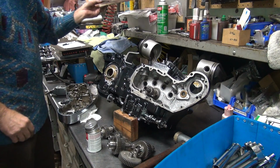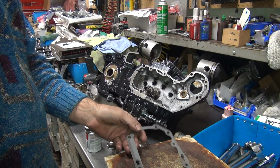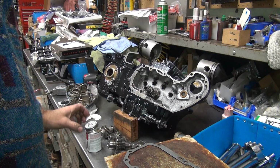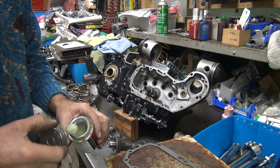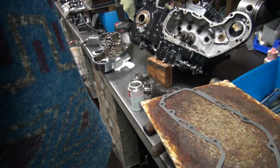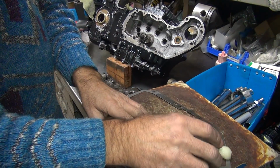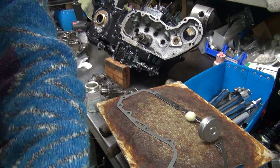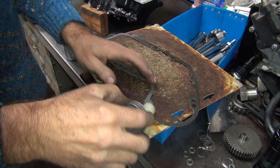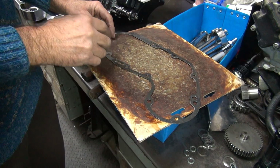Okay. Take my gasket board. Guess why I call it that. So we're going to stick it on the cam cover, or we're going to stick it on the case. Let's stick it on the case. So I'm going to goop up that side first. That way it gets a little tacky. There we go. Now this just wants some smooth, easy coat on it. Told you we're too close. You gotta be quick with this because it tacks up on itself and then it tears.